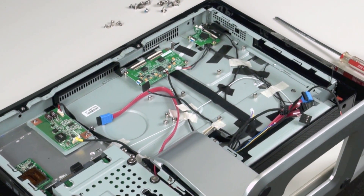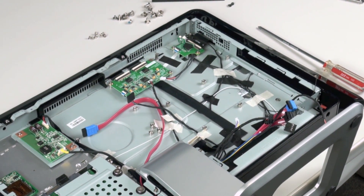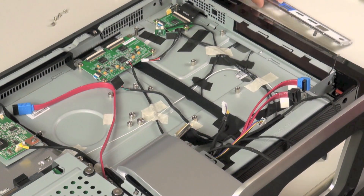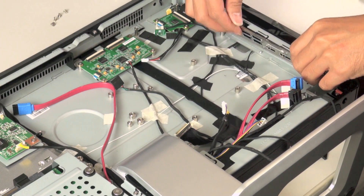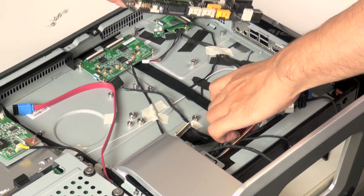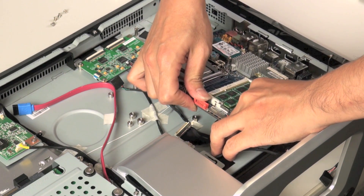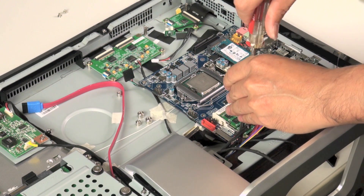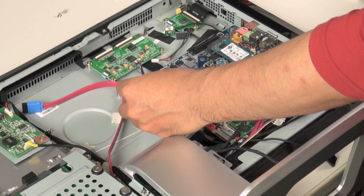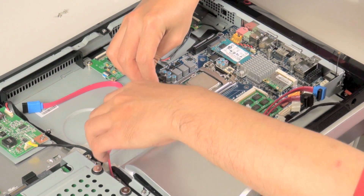Next, you can see the space here for the motherboard. We have some small risers into which we're going to screw the motherboard. The first thing we want to do is make sure we get our I/O shield in there. Now we can mount the board — four screws, one in each of the four corners. Now we can start to connect all of the devices to the board.